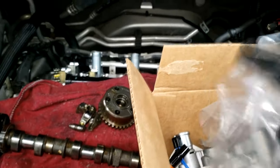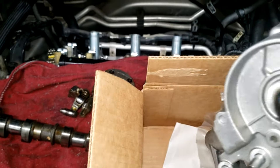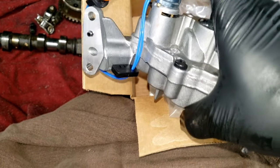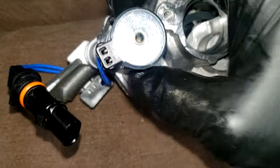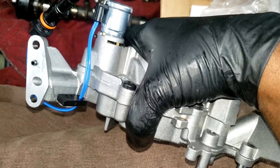Oil pump — this is a dual stage oil pump. I have a P06DD code. I have heard instances of people going out looking just for their solenoid. An oil pump is going to do its job; most of the work is being done by the solenoid and they seem to think that's the only problem. And as you can see, it is replaceable — it's a pin holding that in. Simply pull that pin out and pop the solenoid out. But here we have to do the whole oil pump, and that's what I'm going to do.